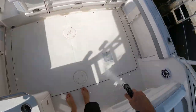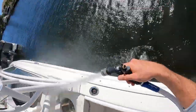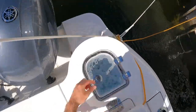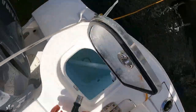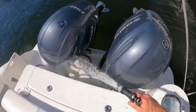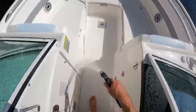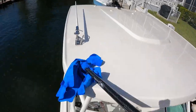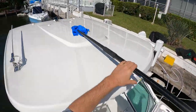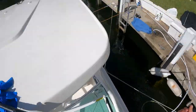If you guys didn't notice, I always work the boats from top to waterline, bow to transom — that's how it works. After I do the wash, I piece it out in sections, wash and then rinse. After I'm done with the entire boat, I give the entire boat another whole complete rinse, just making sure I have no soap left. It's so important — people like to rush this. You have to rinse everything super thoroughly.